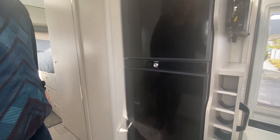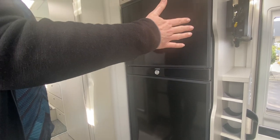Before we start, if you do run your fridge on gas it is not recommended to be on a slope. The fridge does not like to tilt from the right to the left. Just remember, if the nose of your motorhome is up or down that is not very good for the fridge. If the fridge is tilted forward or backwards it's not so much of an issue.